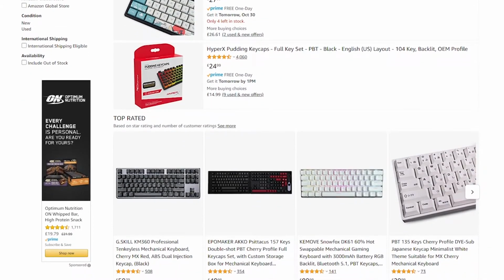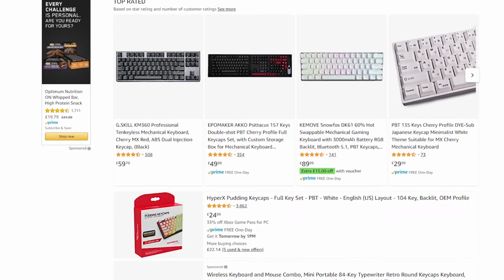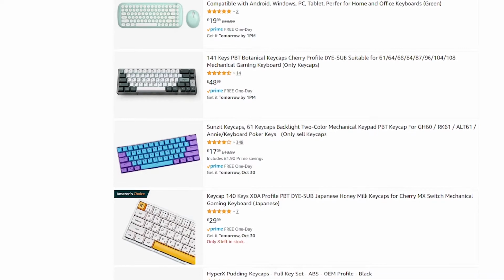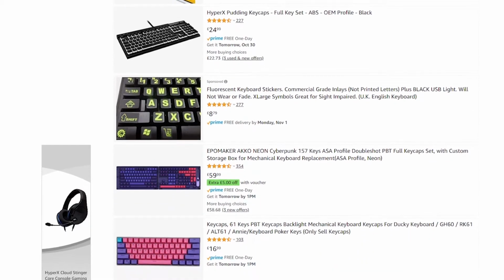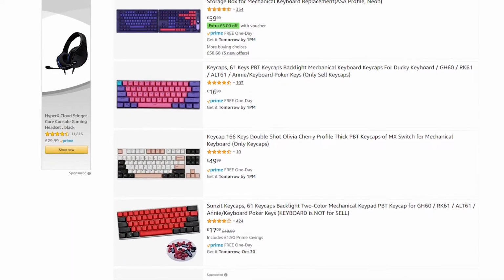This may naturally lead you to online retailers such as Amazon or eBay, but you'll be remiss to find that the majority of sub-£40 keycap sets are 60% ANSI layouts, or even kits such as the one I currently have on my board here from Glinging, that cover a full board with some extras, can offer you near full ISO compatibility, but ISO variants of keys aren't available. The obvious bugbear as well is that the enter key, arguably the most important key of them all, is absent from most of these kits.